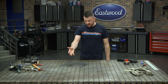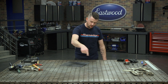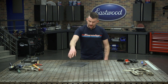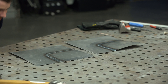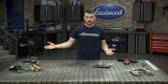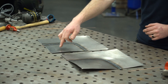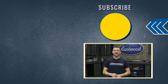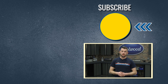Looks pretty good — I took it about 90% of the way there. The panel isn't an actual framed panel on the car, so getting it perfectly flat on the small table is very hard and would take a lot more time. But compared to our reference panel, it is significantly better. This is the process that works best for me: TIG weld it, hammer and dolly, check for highs and lows. Normally I'd grind the tops of the welds flush to the panel — careful not to grind the panel itself, just the weld. Subscribe to the Eastwood channel and visit eastwood.com for more.